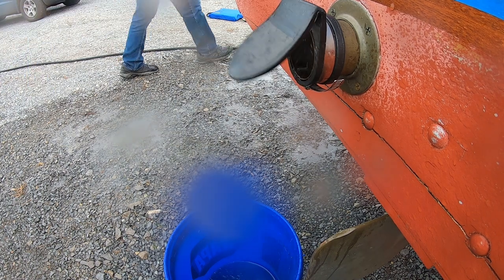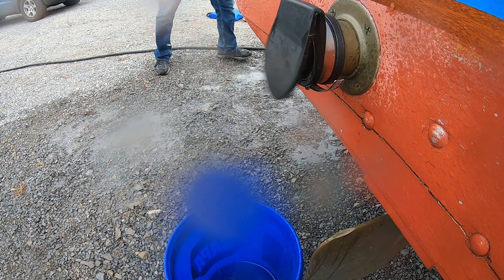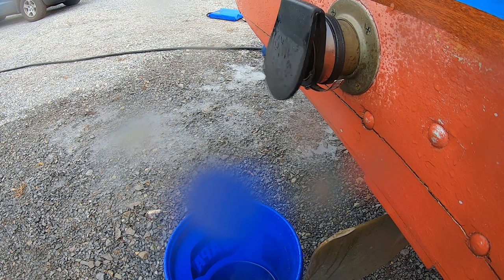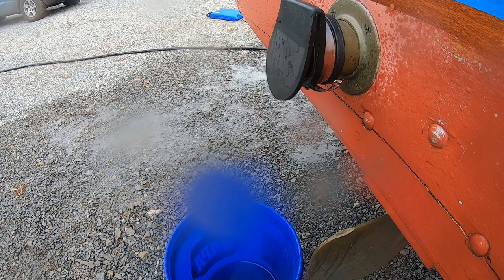Because we drained and emptied the exhaust manifolds and engine block, the only water left is in the copper pipe running back under the floor to the transom. It sits lower than the exhaust pipe and the engine. The motor is not running dry all this time. The pump is filling the engine block and exhaust manifolds with antifreeze before any comes out in the back at the pipe.